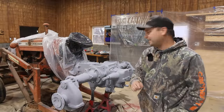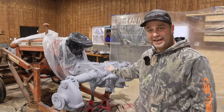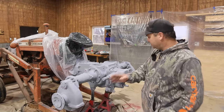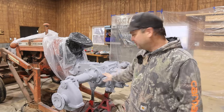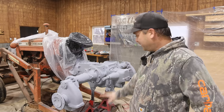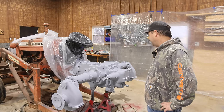So it's been a couple days now and I ran into a little bit of a problem. Where my lint-free rags had left lint on here, I thought I had it all off, but as soon as I sprayed it with the primer you could see all of that lint just pop - you could see it all over this side of the tractor. So I had to take some really fine sandpaper and sand it all down to knock off the lint, and then I had to apply a second coat of primer.